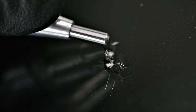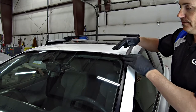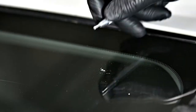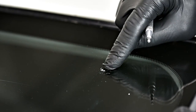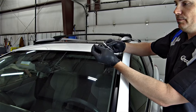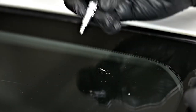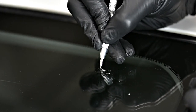What you're looking for is any of the cracks in the repair to move or flex. If they do flex, you know you have to be a little more careful when doing the repair. This repair looks real good. Now we're going to clean out the pit area. We'll take our probe, remove that tip, flip it over so you have a sharp side and a blunt side, and go ahead and clean out that center of the repair with any loose debris.